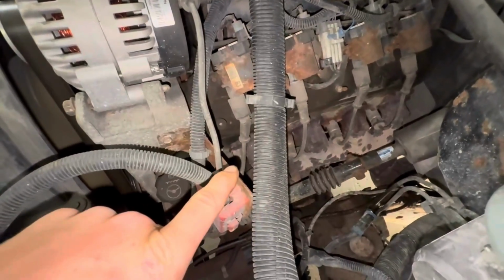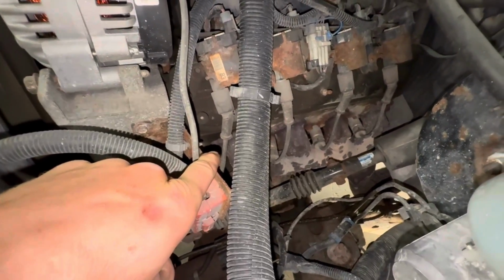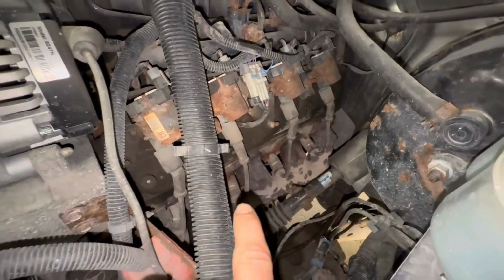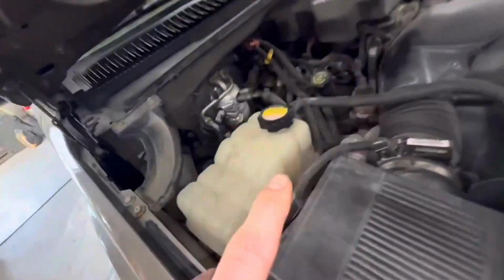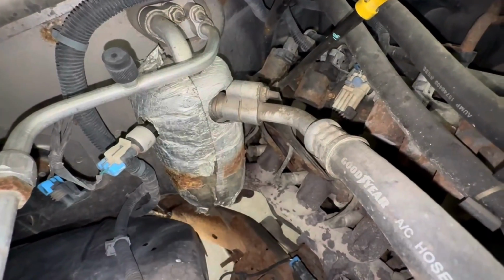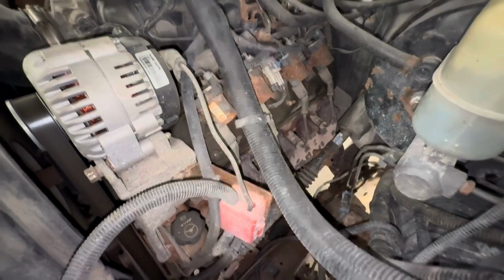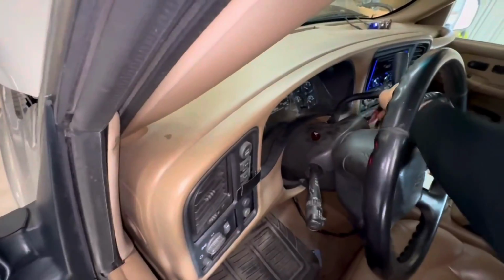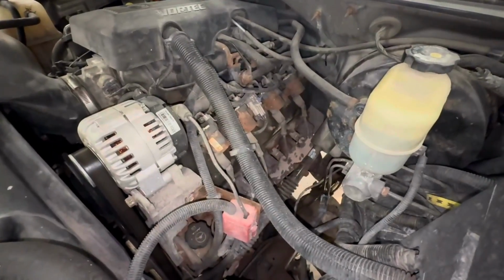We have a broken exhaust stud right there on the very front one. Those all look good on the back, but it's ticking on that front side and also back here. Front stud's busted, and the very farthest one back is also busted. I can kind of hear it right there. All right, let's start tearing into this.